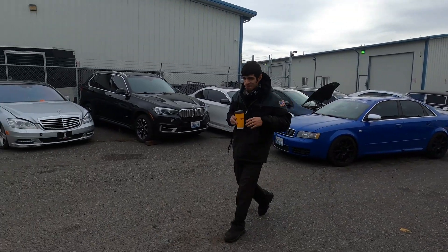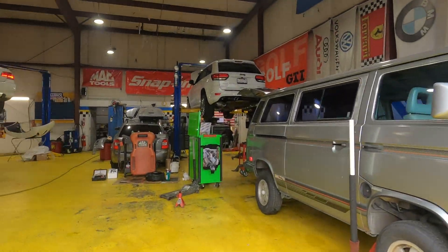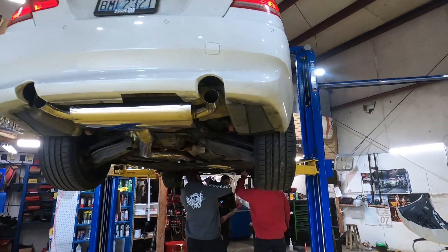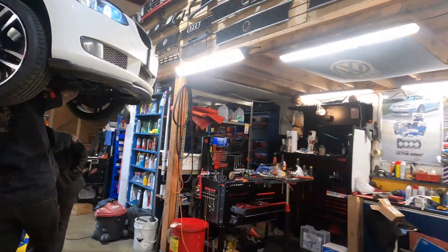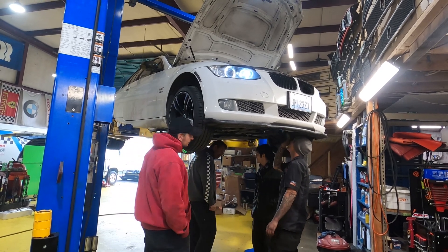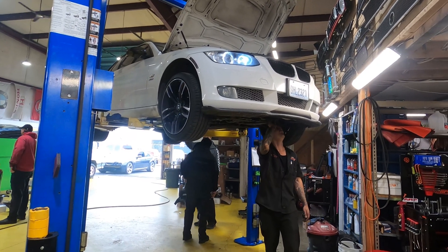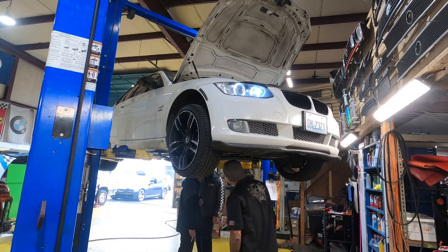This is Christian at J Sport Auto Works. We just wrapped up the install on the turbos — looks like no more smoke coming out the back, which is a beautiful thing. Everything's starting to burn off. We just started her up to make sure everything's holding pressure, not leaking any fluids. Corey did a coolant pressure test last night and she was holding great. Just letting her run for a bit — gave her a quick couple taps on the gas pedal and she sounds mean. Looks like all the residues have burned off from the fluid and gold heat tape.